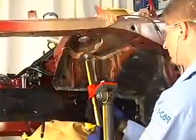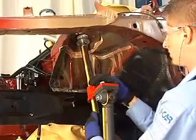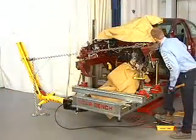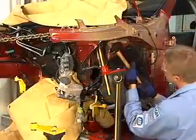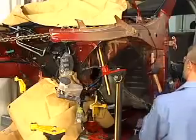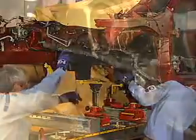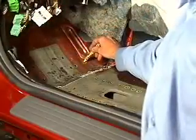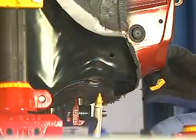After the cowl to frame rail fit-up is corrected, the shock tower fixture is reassembled to check the position of the shock tower. The frame rail is removed, and a slight corrective pull is made to the shock tower to position it correctly. The cowl area is stress relieved to allow the shock tower to remain in position after pressure is released. With the shock tower positioned correctly, the rail is reinstalled to the fixtures to check the fit-up one last time and to mark the positions of the welds so that the flanges can be prepared and GMA MIG plug weld holes can be drilled.